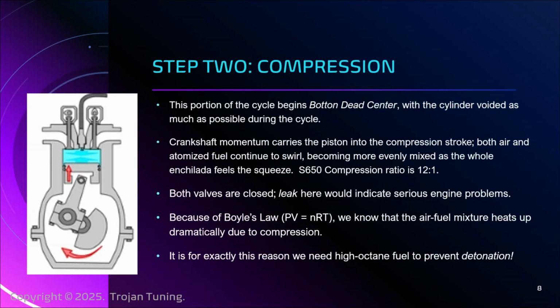And if I assume they're magic dominoes, and as they lean one way or the other, they don't fall over for whatever reason. Low octane would be sort of at a downhill angle, such that a slight bump of the first domino will set the whole chain reaction going quickly, right? Higher octane flattens that out, where it is a little harder to invoke the chain reaction, right? And, at the highest, that's like 93, 94. It's why we need to put premium gas in our S650s.